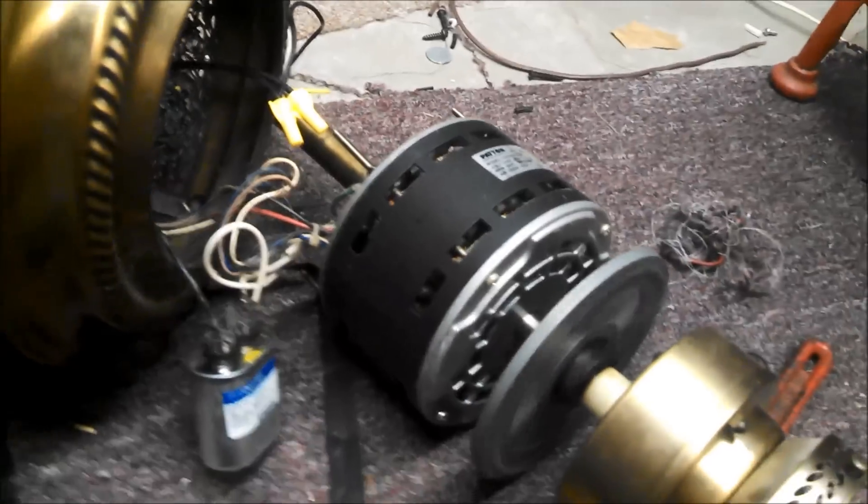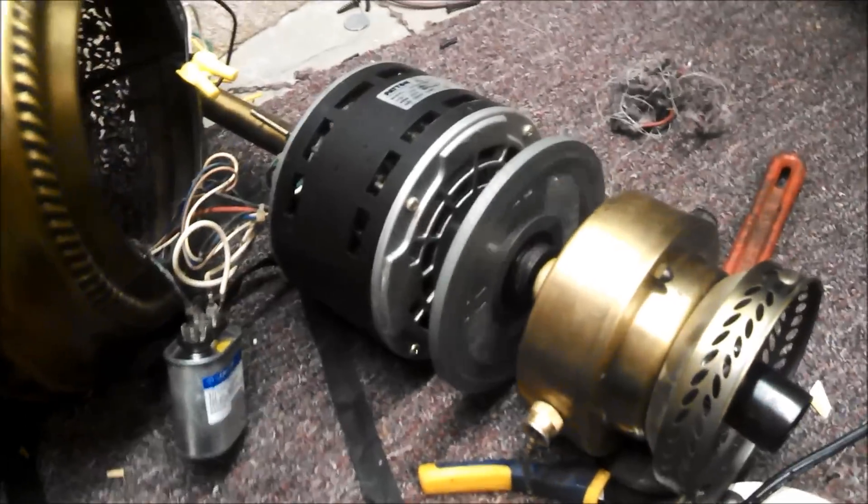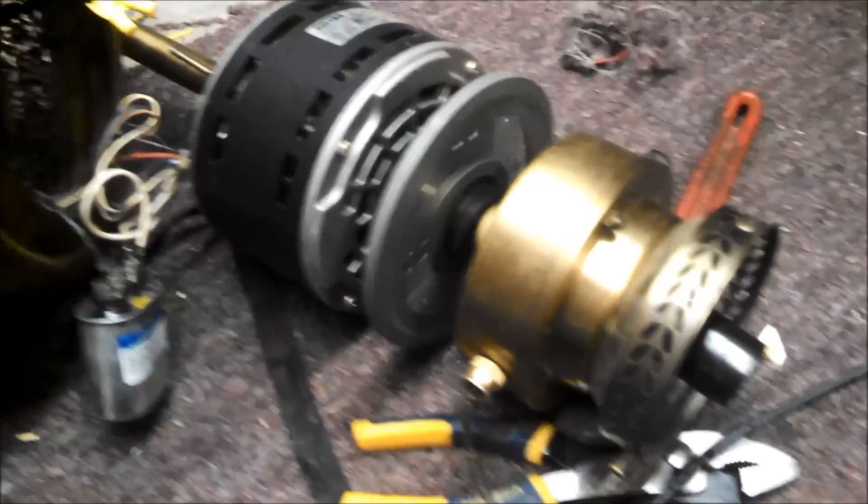I found out that the black lead — the individual black lead — was supposed to be connected to the reverse switch but had come disconnected. When I power it up now, it seems like it works perfectly. We'll try reversing it — does it go the other way? Yep. So because that five capacitor was leaky-looking but tested good...